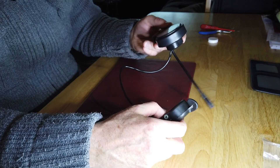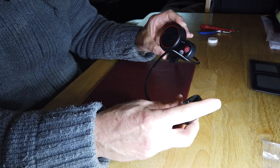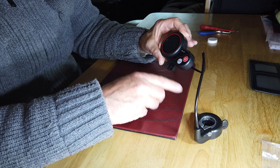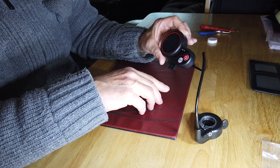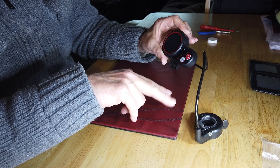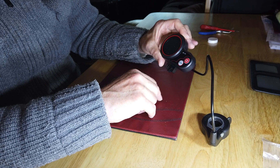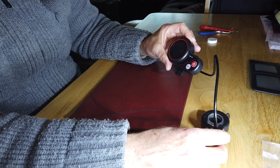Put these over your handlebar and reconnect the speed controller with your new thumb controller. Test it out, and if it doesn't work you've possibly got two wires mixed up the wrong way — you can swap the red wire and the white wire around. The black wire is always the middle pin on these controllers. Hopefully you'll be able to do that yourself — good luck.